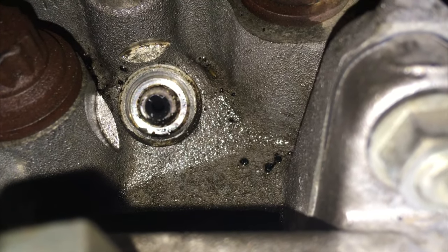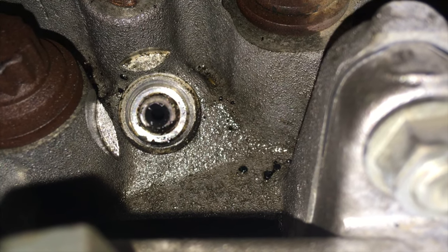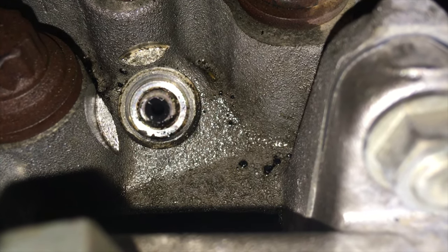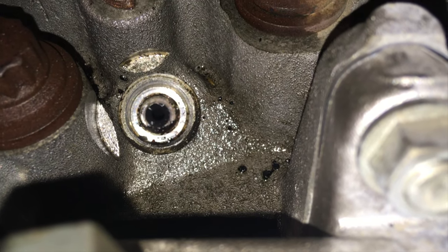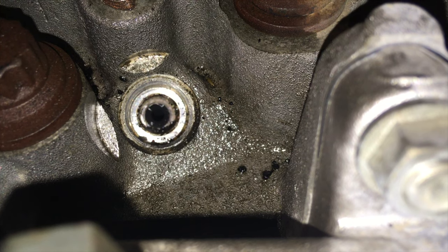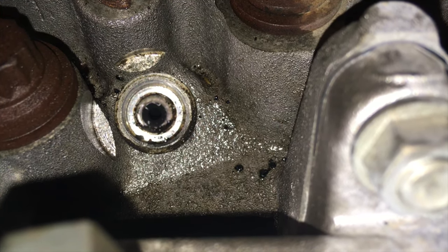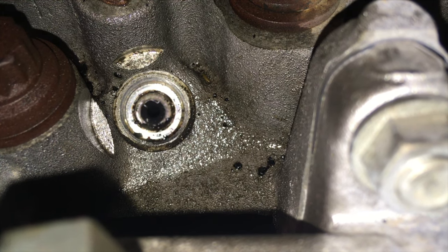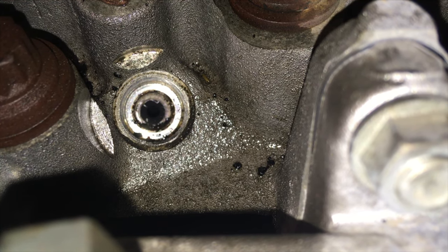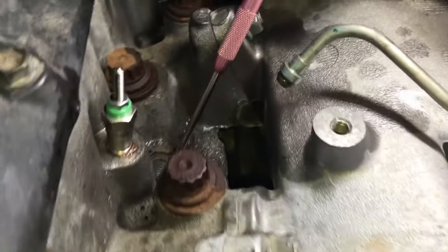The rear injector may have been over-fuelling slightly compared to the others — it was blowing a bit of smoke on start. Now let's get the seats out. Get underneath the seating washer with your pick, lift it up, and bring it out — just like that. All four seats removed. You can see what's left down in the hole — there are other components down there but don't remove those. Just vacuum and polish up that seating surface to get it nice and clean.